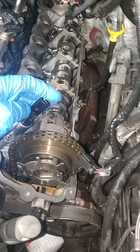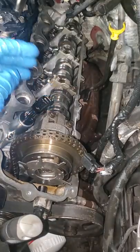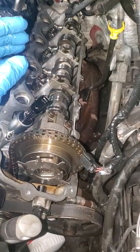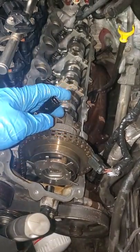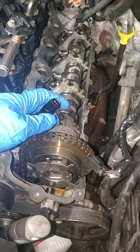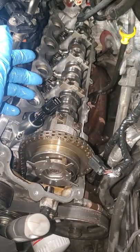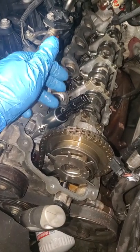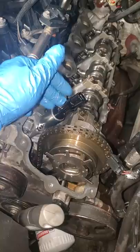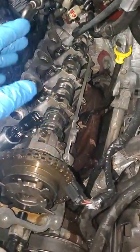That's how I diagnosed mine. On the last truck, when I disconnected one side and it wasn't shaking, I disconnected the other side and it started shaking, so I only changed the side that wasn't shaking. On this current truck, the car was shaking so bad I changed the VCT solenoid on this side and also the other side. I got them from Ford original, but the code is still showing with no shaking or anything.